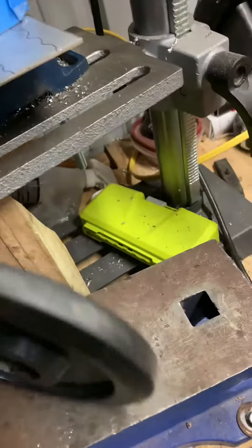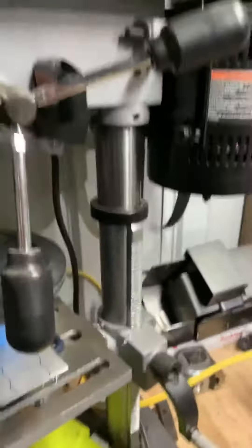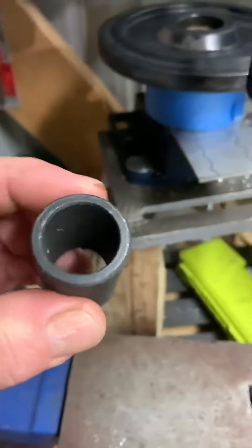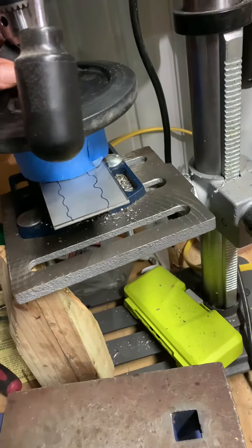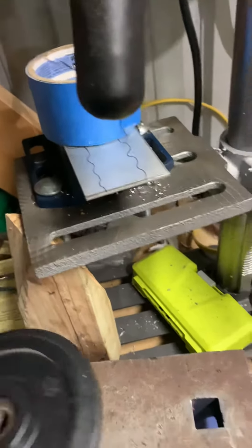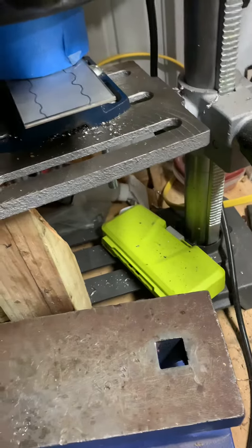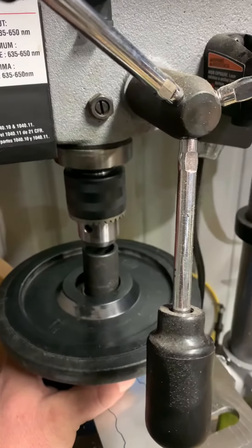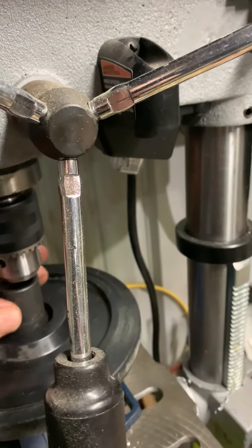Make sure you put it on this side — that's the side that you press against. Now that that's in, you can use an 18 millimeter socket if you want, or a flat piece of pipe. Put it in there first, get it nice and lined up, centered on the inner race.